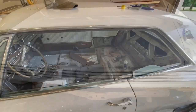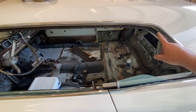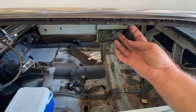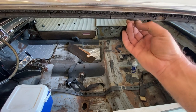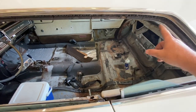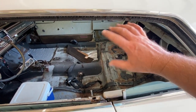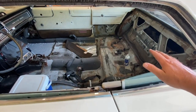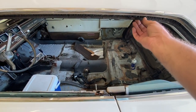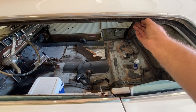All right. Now we can start on these roof rail seals. These are the original ones. I'm almost positive because there is this plastic keeper here, and usually people don't put those back on when they put new ones in. That tells us that there is a wire inside this, and that makes the job so much easier to pull this out. It is very messy. Get your shop vac ready, but this makes it so much easier. This stuff is crispy, crunchy, nasty. Oh, gross.